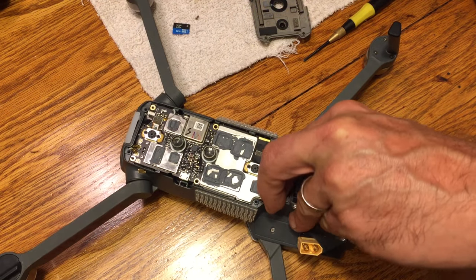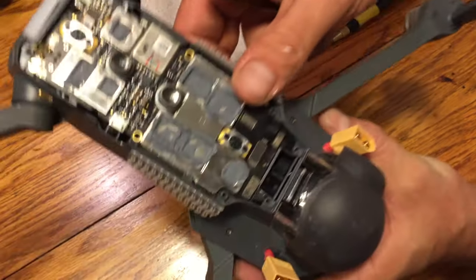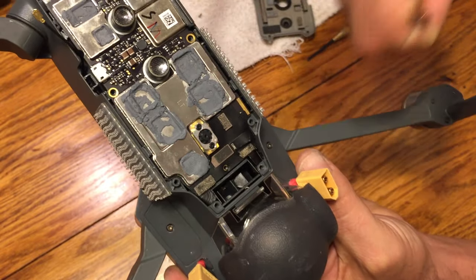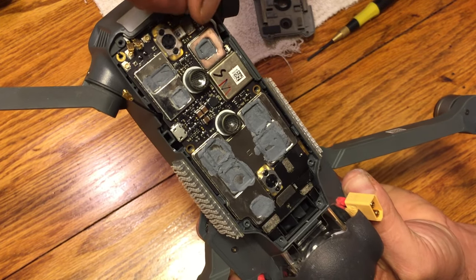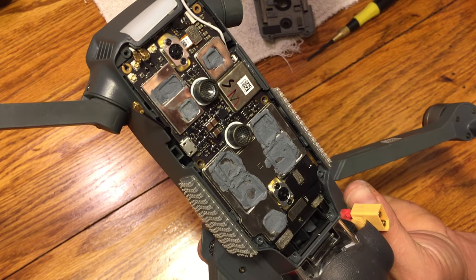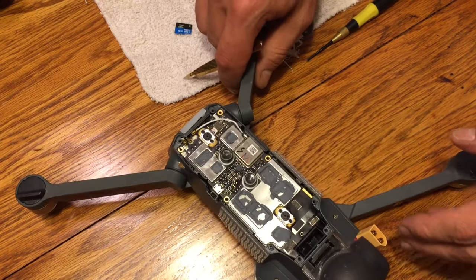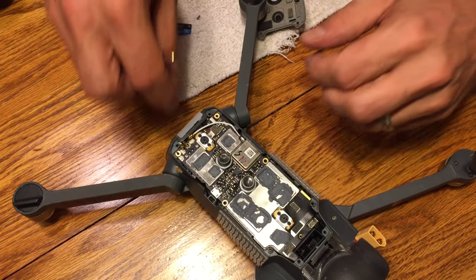And so go ahead and get all three of the gimbal ribbons in place. Hopefully the cam shot up next will show a little more close up here. But again, all three of them need to be put in. Just go ahead and put them in over the top, firmly push it in. So you can see here, I've got all three of them in. Just get it just over the hole and push down nice and firm. It should pop right in place. If it doesn't pop right into place, you might have the alignment off just a little bit. Try not to force it. It shouldn't be really hard to go in. It'll take a good little firm push, but nothing too complicated.